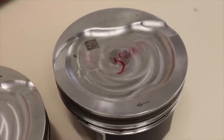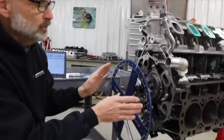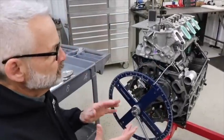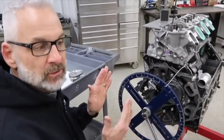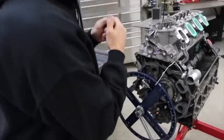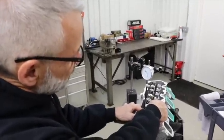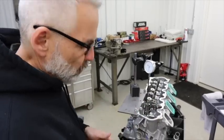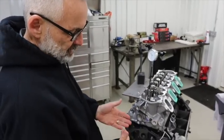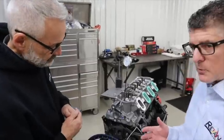What we're doing here is going through the motions of checking piston-to-valve. We've already set the degree wheel so we know where top dead center is at zero. Because this is a VCT engine, we check it fully advanced and fully retarded. Right now at 0.8 degrees after TDC in the full retard position, we have just over 207 thousandths piston-to-valve. We check from about 6 degrees before TDC until about 14 after, and typically the minimum is around 8 degrees — but we check many points to capture the entire curve.